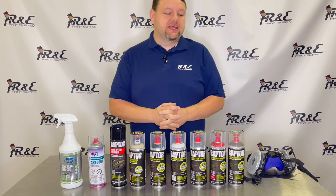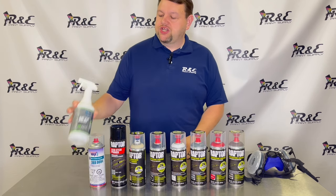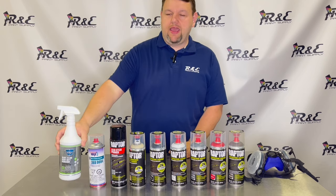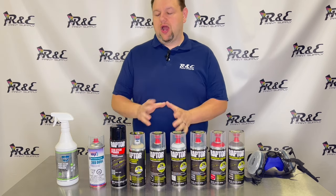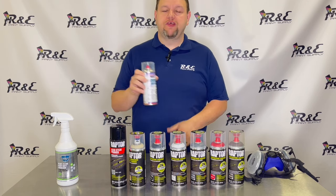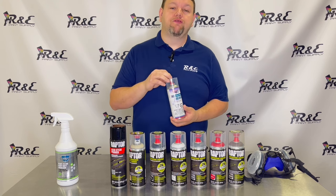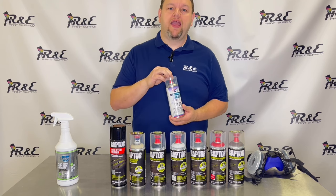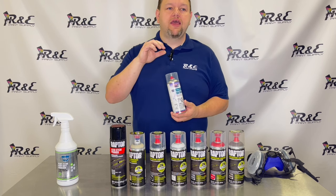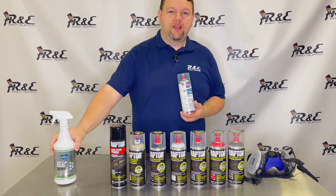This is a good process we're going to go through to recoat the inside of that bed. We're going to start out by using the Spray-on heavy duty degreaser, then rinse that well and dry the trailer. Then we're going to come back with Spraymax wax and grease remover — this is an excellent product. Any kind of wax and grease remover you really need to use prior to the painting process, as it helps get any contaminants, oil, or grease that the Spray-on didn't remove.